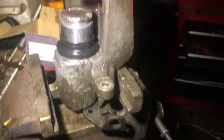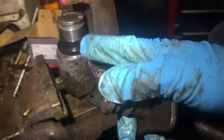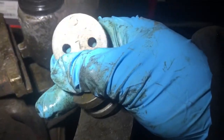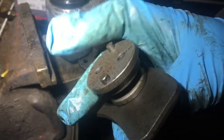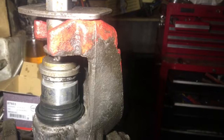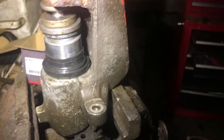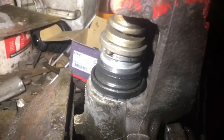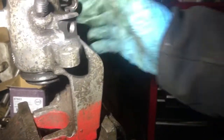How do we do it? I have one of these wind-back tools. If you're looking online and you only want to buy one for Volkswagen or Audi TT, there are different heads. This is head number seven — they have loads of different pins on top in different sizes. I bought a whole kit, but for VW or Audi you're just going to use number seven. Now let's rewind this piston back in. This plate sits down here but we don't have enough room just yet — that's why we lubed it up well, so it will turn. Now we wind in the piston. Sliding lovely and easy. Perfect.